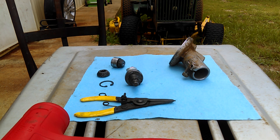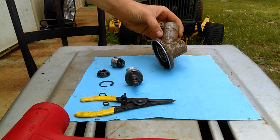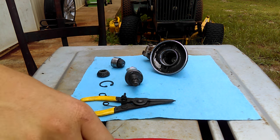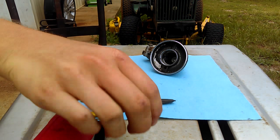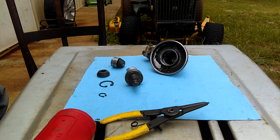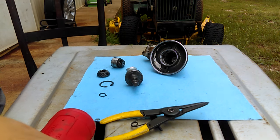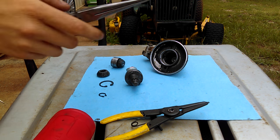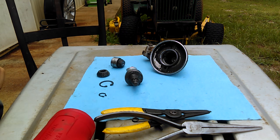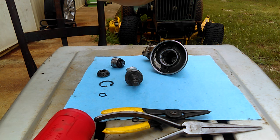Just to clean it — they don't have any kind of grease fitting on them. So basically all you need is a hammer, internal snap ring pliers, a little ball peen, a pair of needle nose, a small pocket screwdriver, and a 12-inch extension.